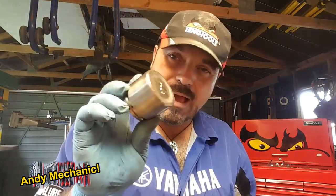Right, I'm back. Hi. So piston, good. Absolutely, really good. Actually, very surprised about that. Seal kit or seals on the front caliper. Well, the dust seal had a huge hole in it, so we need a new seal kit. You can't just buy a dust seal. You've got to buy the dust seal, the main seal, and the clip you should get.